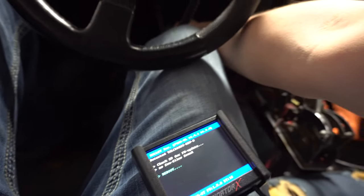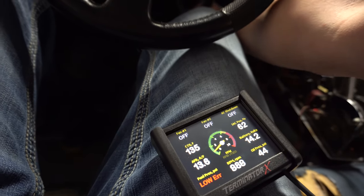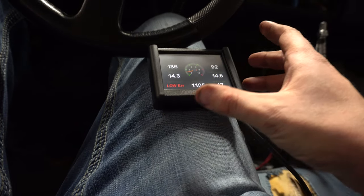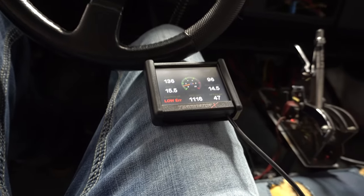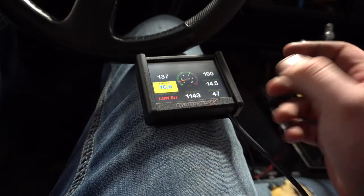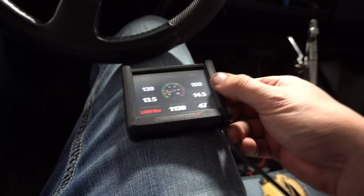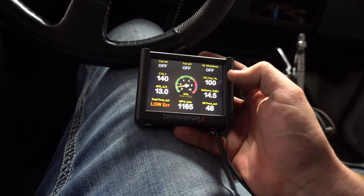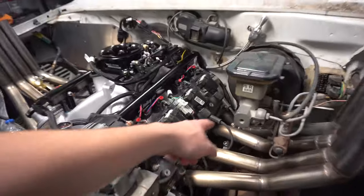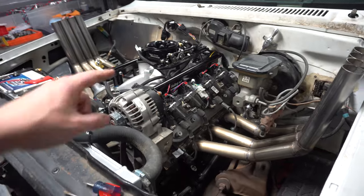Found the hole. Coolant temp, air/fuel, RPM — oil pressure looks good, battery voltage looks good. The IAC is a little too high, so I need to open it up until the IAC closes. Well, I missed a plug wire, so we were only running on 7 cylinders through that whole thing. Going to go ahead and fire it one more time and see how it runs now.